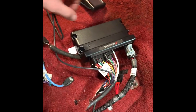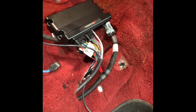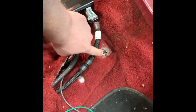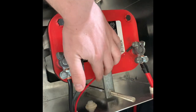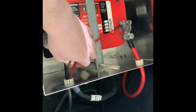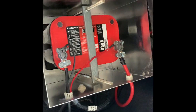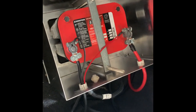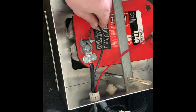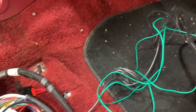Everything's strung out in the car here. The Terminator X goes under the passenger seat — pretty straightforward, everybody knows that. First thing is power and ground to battery. My car has the battery in the back, so I've got the cable running underneath the carpet down around the kick, all the way under the back seat. Holley basically gives you two wires with ring terminals that go direct to your battery — positive and negative — and they tell you to run it straight to the battery.